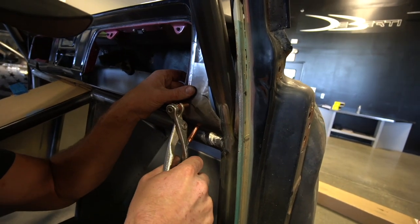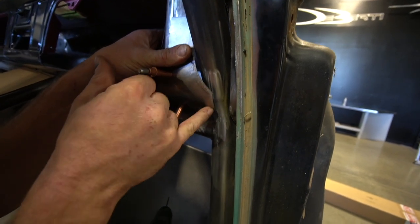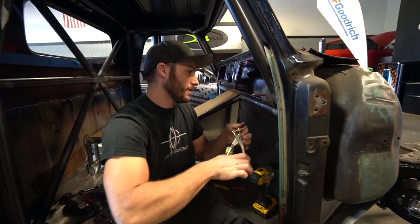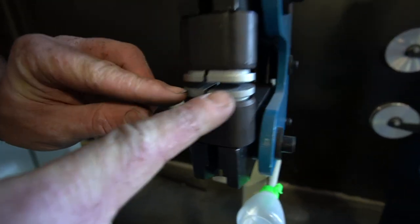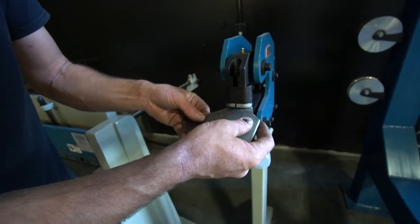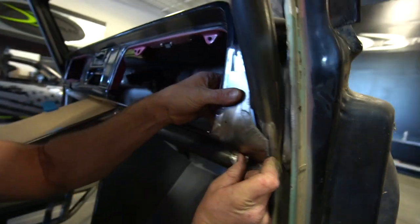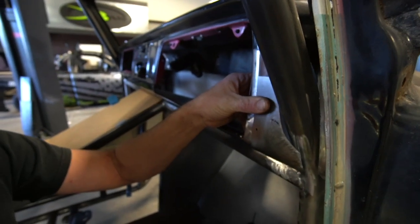Let's get back to work. So this panel will go in like that and I just have to shrink this edge out. What's cool is you can make something and trick people into believing that's how it was from the factory. Right now we're using the shrinker-stretcher — it grabs the metal and literally just pushes it together to shrink it. It doesn't take a lot of pressure, you just go in and shrink everything. It has a really nice contour to it, so when someone walks in and sees this it looks factory.